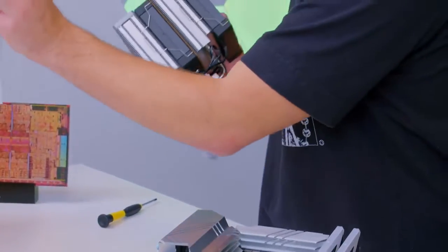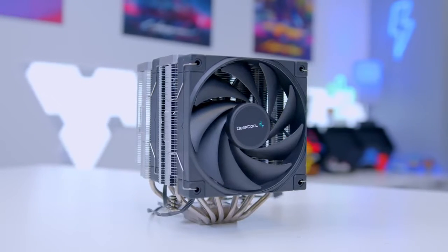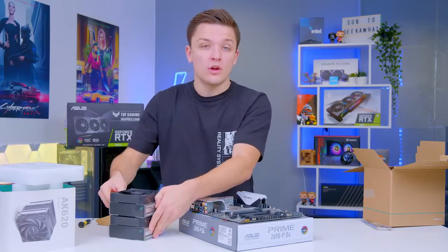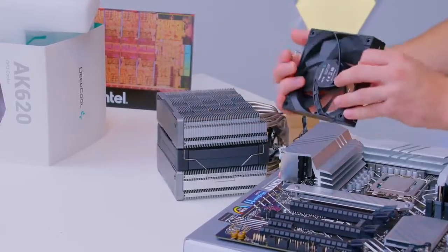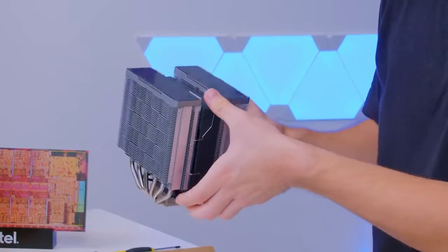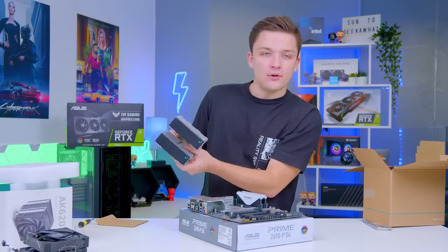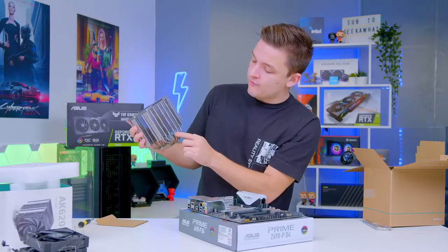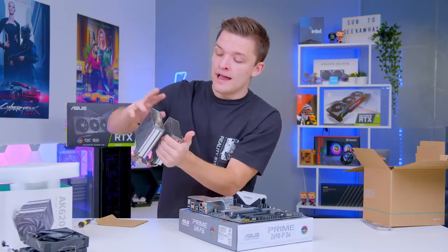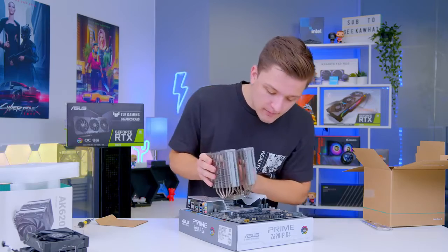A segment of the market that hopefully will see stock return somewhat to normal. This CPU cooler is just a monster. What we're going to do is unclip at least this fan here — that will make installing both the cooler and the motherboard a lot easier. In fact, we need to remove both fans, as one will get in the way for actually screwing it in. And that looks amazing — you've got 12 heat pipes in total, which is really great for heat transfer. You've got a nice deep core black design at the top and a good-looking silver heatsink. Hopefully we shouldn't have any RAM clearance issues — and we don't. This low-profile memory is going to save the day and allows us to pop the fan back over the RAM a little bit later.